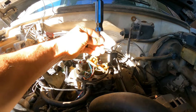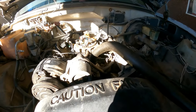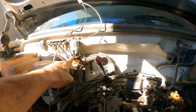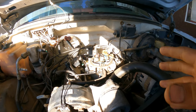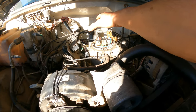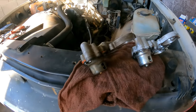The way you do this: there is a relay for the fuel pump, so you unplug it and crank the engine — sometimes it starts — and this relieves whatever pressure is on the regulator so there's no pressure buildup when you remove the top and it won't splash all over.